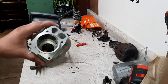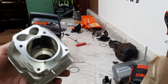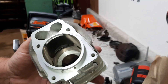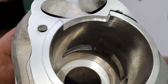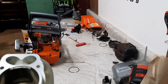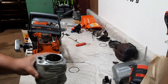Got the base all turned down. Squish set at 24 thousandths after machine work - no base gasket. Landed at 76 and a half intake, 105 exhaust, 120 transfers. We're gonna go to 102 exhaust, 118 on the transfers, widen things up, flow them in a little bit better, and that ought to make a good runner. So I got them laid out and now we get them ported.